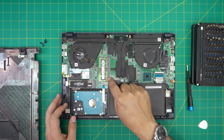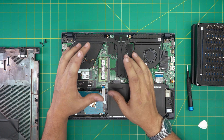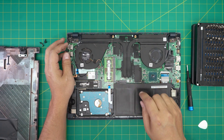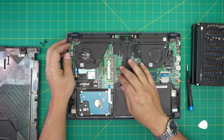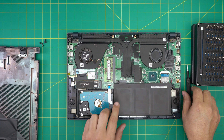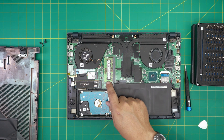Down here you'll see there's only one RAM stick. The Task Manager might show two out of two slots, but it always reads what the BIOS is programmed for, not what's physically installed. Some people say you need to remove the battery before upgrading RAM — that's absolutely not necessary. There are three screws to remove the battery, but you can leave it in place to upgrade the RAM.